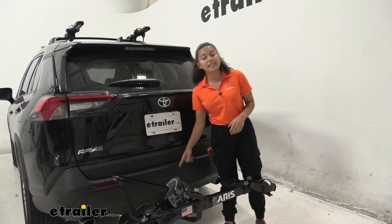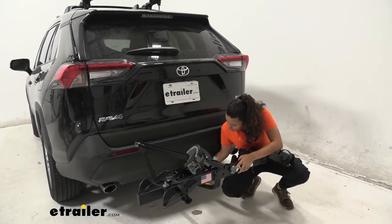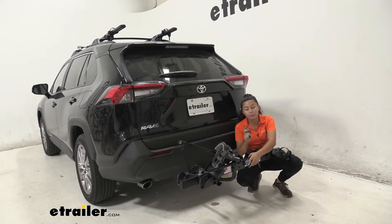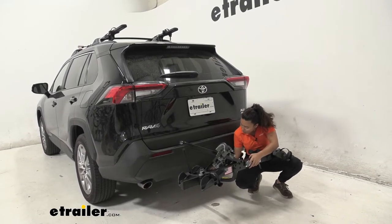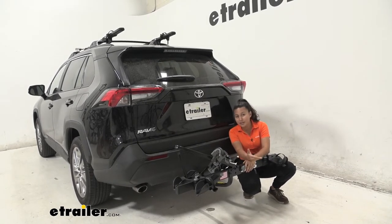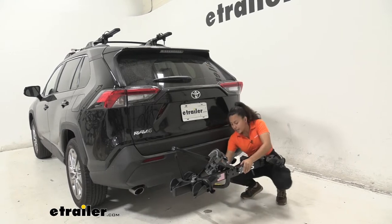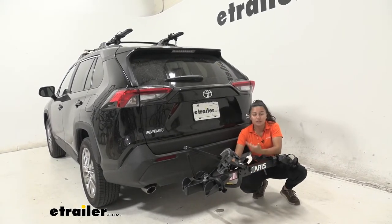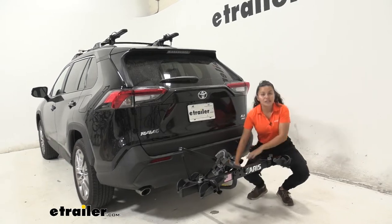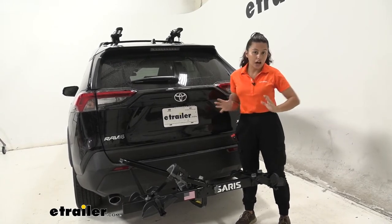As for how this fits into our hitch, this has an inch and a quarter shank with a 2-inch hitch adapter. It has an anti-rattle bolt as well as a lock, so it's nice to see that you can lock your bike rack up to keep it a bit more secure. I use a socket wrench with a 3/4-inch socket just to tighten that bolt down — I recommend you do the same, as it's a lot easier and faster that way. As I shake this side to side to mimic road stress and vibration, you can see that even with that adapter, most of the rattle is taken out.